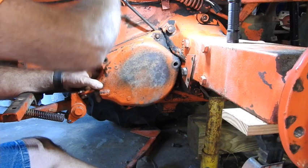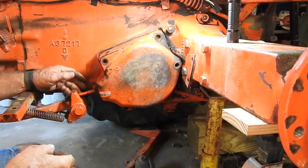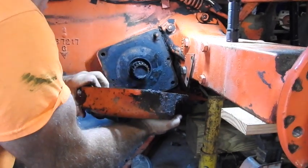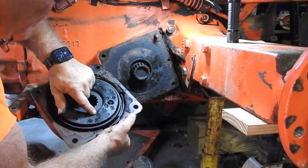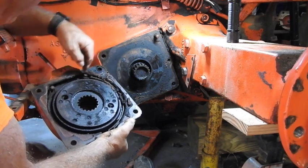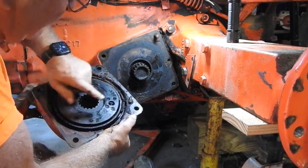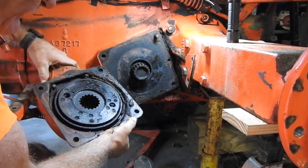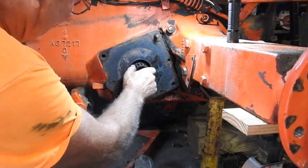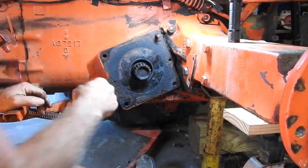You can see it wants to pull out and then pull itself right back in. Well, I think we're fixing to get it. It's got a disc surface, but it's also got a band around the outside edge — and look at all the crud and corruption that's inside here. The band is definitely stuck. I don't really know what I'm looking at — this is a new one on me, so I'm going to have to take that apart and figure out what's going on. Obviously it's been leaking just a little bit of fluid, a little bit of rear end grease, so we've got to clean all that up.